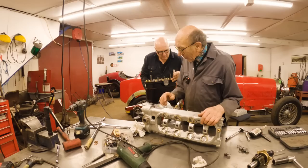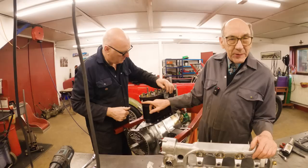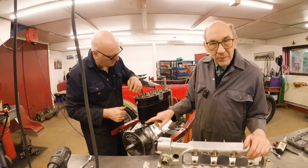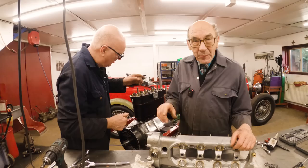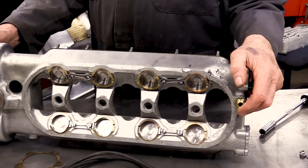So obviously when cars used to go up hills a long way, sometimes this bit used to fill up. So one of the modifications that was done was to put this thing in the back and drain it into the back into the sump. So that is not strictly original, but I think they did it from, you know, the earliest days. And we didn't do that. That was already there. So somebody else had done that. So any minute now, we're going to drop this on and hopefully do the valve timing.